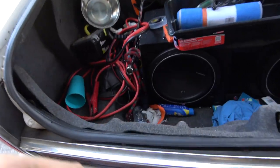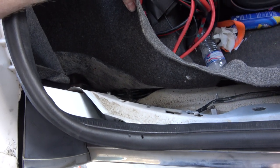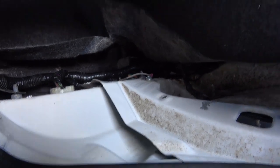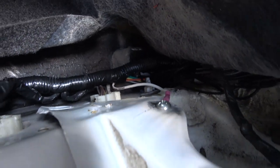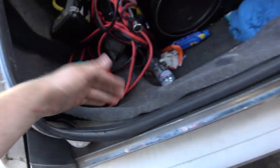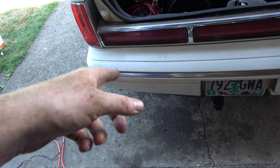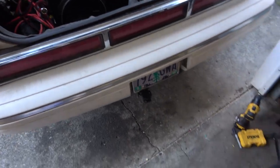I just got all those back together. That little bundle of wires down there is actually for the backup camera video signal — I'm going to do that later, but everything else is kind of tucked away. You can see the little wires down there for the trailer stuff. I'm going to leave that open because there's enough room to add stuff through there. I still have to add the trailer brake controller wire, which should be a yellow one with a white stripe. That'll be our connection for the trailer brake controller.